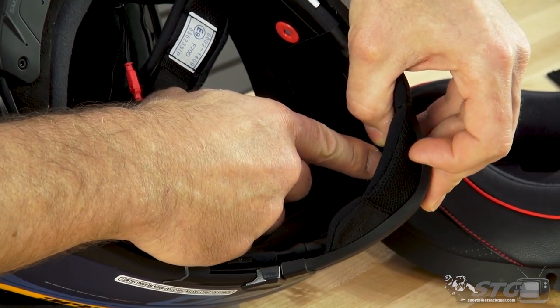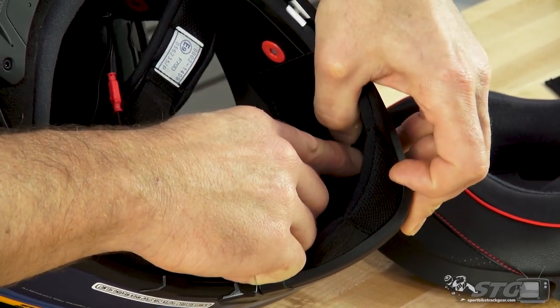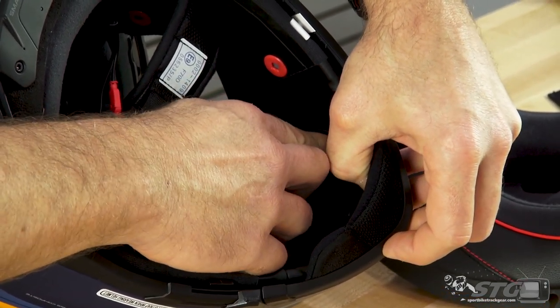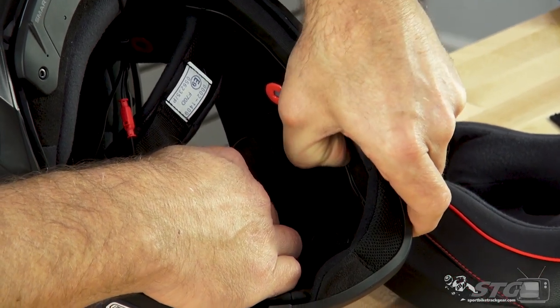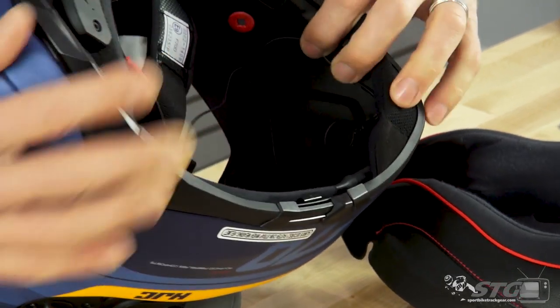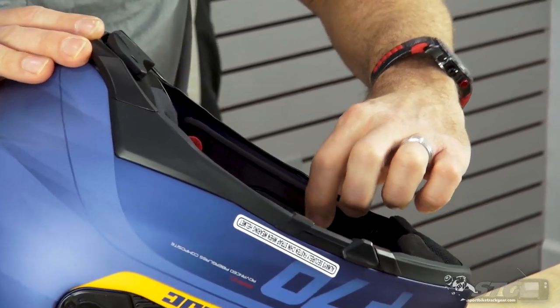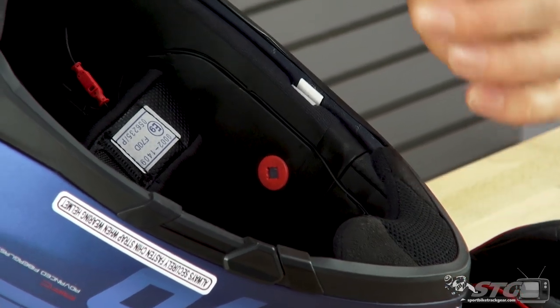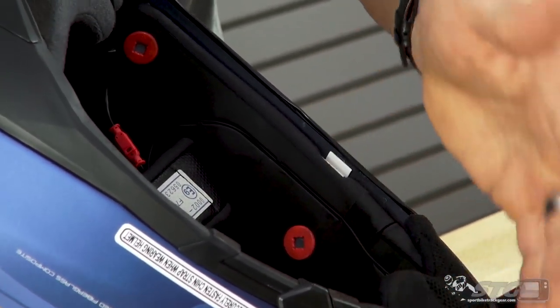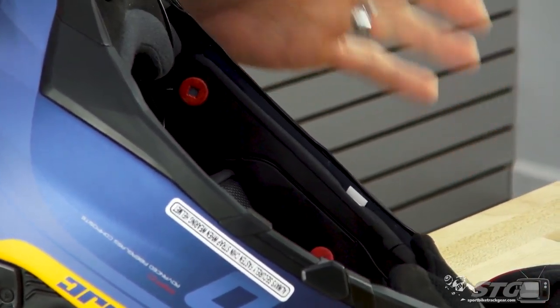A lot of this is self-explanatory — you get the helmet in front, get it torn apart, and you're going to see exactly what I'm talking about. There are little tabs that toggle from side to side in that channel that are used to secure the harness that goes to the button mic. Just a little bit of pressure with your fingernail to get it to go past that tab — that retains it. Once you have that harness slipped into position, past this seam where they seam the internals of the helmet, it doesn't stay in that channel as well as it does up front. Don't worry about that, because your cheek pad installs right here — once you reinstall the cheek pad, it's going to hold it all in place.